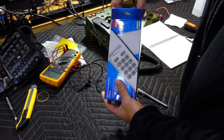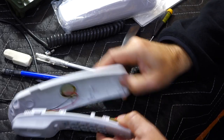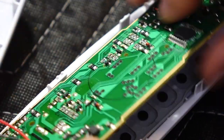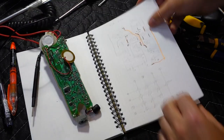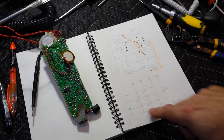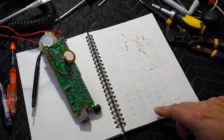I went for the RCA slimline corded phone for $9.99. This one should be straightforward, except for the keypad and its connections, because it's integrated into the PCB itself. After a little bit of double-sided PCB reverse engineering, it's actually arranged in a very logical way — columns and rows on the whole keypad, with flash and redial off the side.